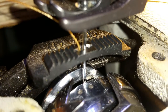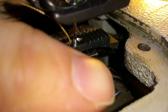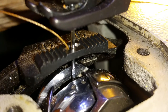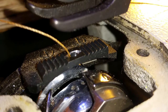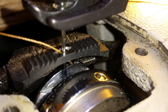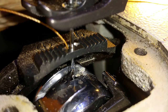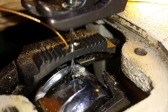I took the inner plate off so you can see the bobbin case right there. There's the needle. Now I'm going to make a revolution — there's the hook, it goes past the needle, comes down, down, down. Now the needle is on its way back up and BAM, just above the hole on the needle.